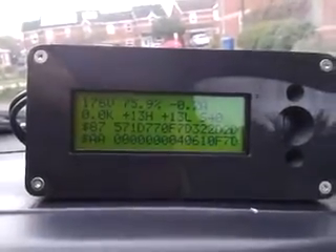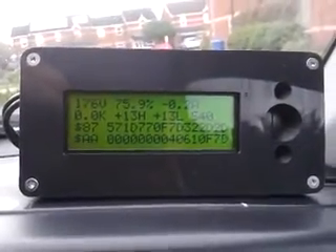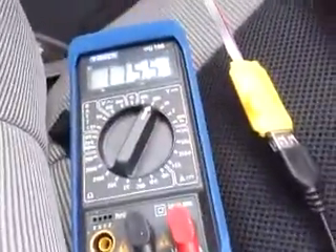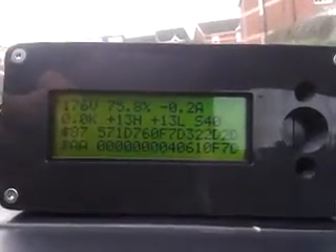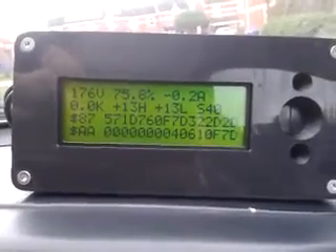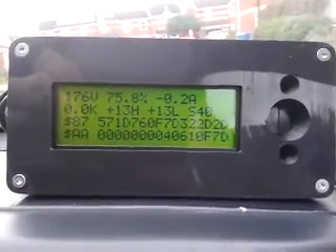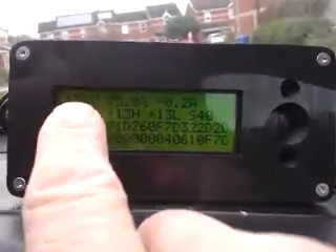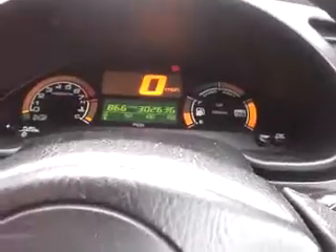As you can see, the actual voltage indicated by the BCM gauge of the super cap pack is 176 volts. The absolute maximum is 190 and the absolute minimum is 110. I've also got a multimeter here to confirm — you can see it's about half a volt lower than the BCM gauge reported voltage, which is fine. I'd rather have this reading high because this voltage is what the decisions are made on for when to stop the system and when to stop regen.